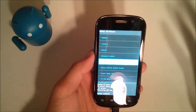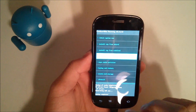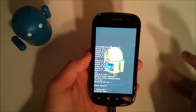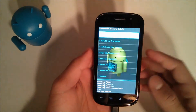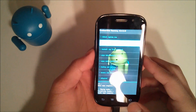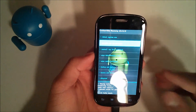Once the backup is complete you'll get a confirmation screen. Next, just like any other install, go back and wipe data / factory reset. Scroll down until you see 'Yes' and confirm — this is going to delete everything, but it doesn't touch your SD card, so don't worry about that. Then you can also do a wipe cache partition, and under Advanced, wipe Dalvik cache. These are extra steps you can do, though you don't have to.